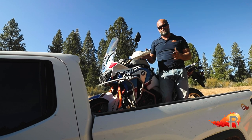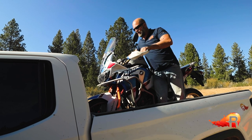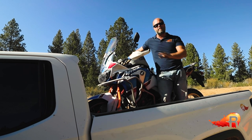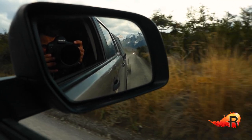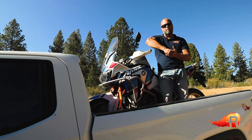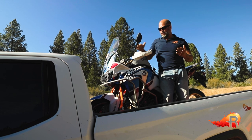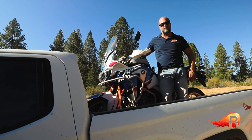The reason I don't like to use a fork block is that you're utilizing some of the suspension of the forks for you. If you encounter a huge pothole on the road, having a block in there means the bike won't be able to compress anymore. By not having the block in there, you allow that front suspension to work a little bit in your favor and absorb those imperfections in the road.